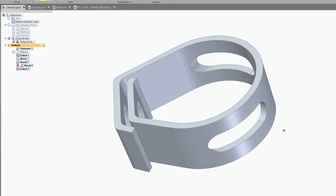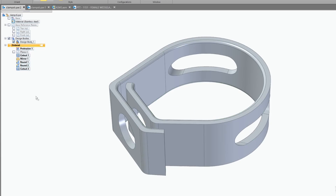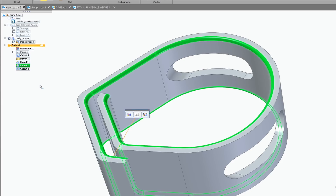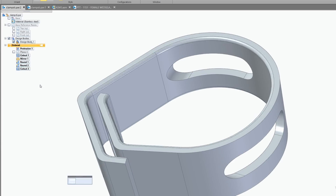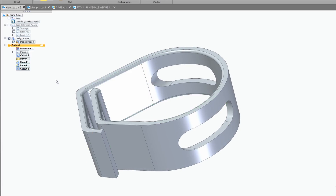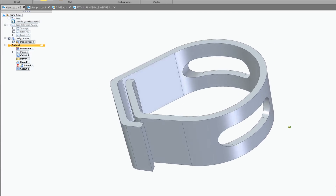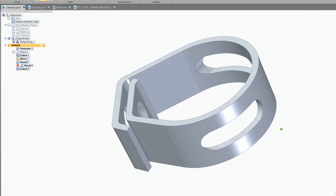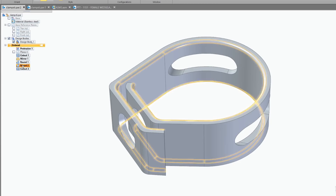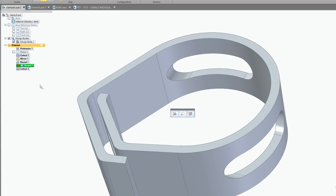It doesn't appear to be any chamfer or soft radius on the clamps. I modeled quickly the Shimano style clamp because it applies to this as well. This is your Shimano style clamp — it's probably stamped and then bent into shape by a bending machine. And this is the kind of radius feature that I'd want to see — just a half or one millimetre radius on the corner to stop that sharp corner biting into carbon. Why don't they put that on there? You could easily form that as part of the stamping tool, so it's swaged over the corner softly so you didn't damage the carbon. If Canyon hadn't done that, they need to do it. Shimano need to start doing it. All the companies need to start doing it because of the curvature of where the clamp clamps on the bars — you do get that biting top and bottom. So bulletin to all component manufacturers: please put soft chamfers or radiuses on anything that clamps on carbon.